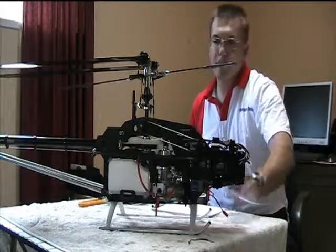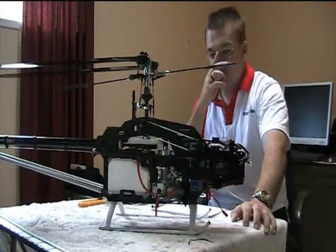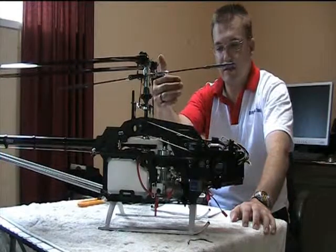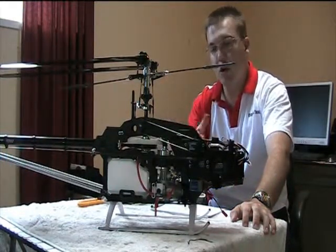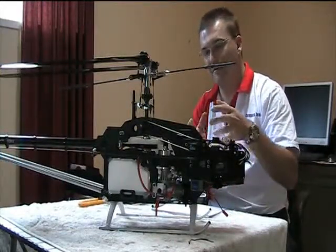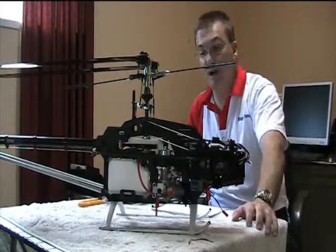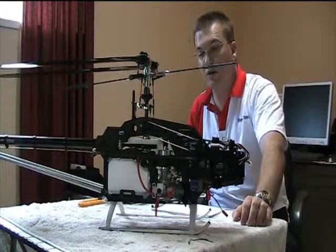However, the fan on the 3D Plus is only drilled for one magnet. So if you use a magnet pickup with a Hall effect sensor, you'll obviously have to either drill out the other side of the fan and install both magnets for balance issues, or you will have to put your entire clutch hub stack and fan stack onto a high point balancer after you insert your single magnet, as it's pre-drilled in the fan for a single magnet. So you'll have to rebalance that if you choose to go that route.